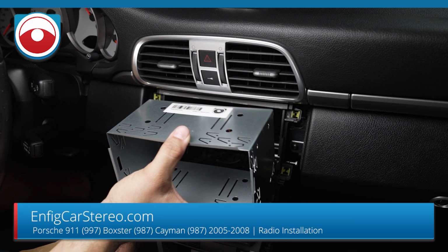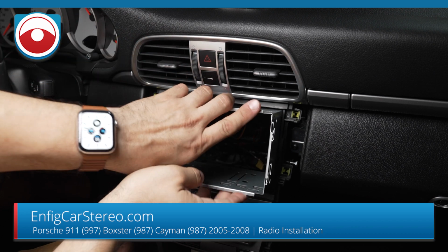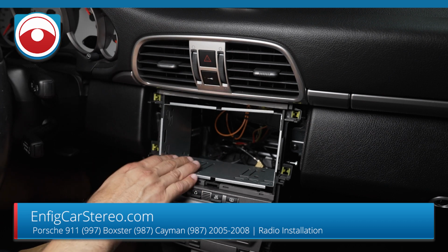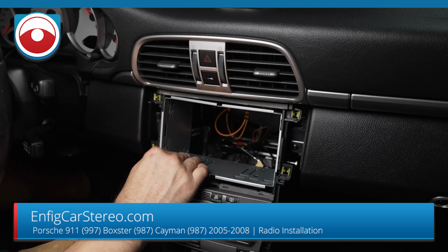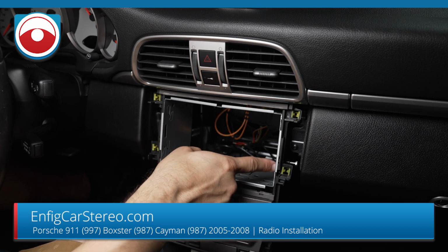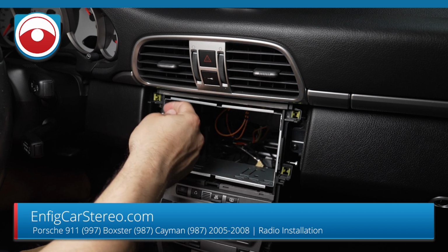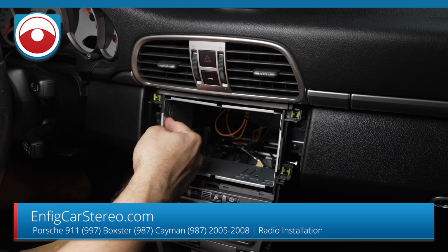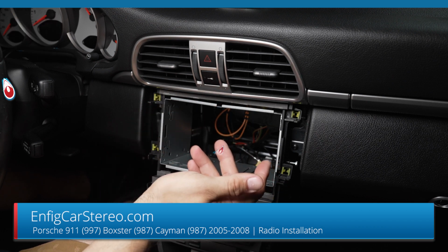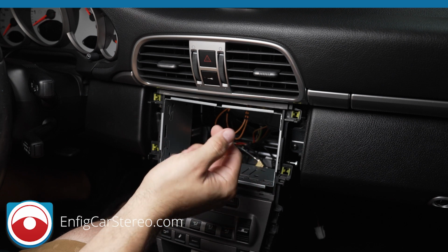You get the metal cage. This is a universal cage that we use in many of our kits. It's not made specific for this car. All right, now this goes in, and this is kind of designed to float in the middle. What I usually do is line it up and trace out where these holes are with a silver marker. Then I go in with the Dremel and cut it out, so that way I have places for this to bend. So it grabs. Not bad. I don't like doing it, but it's the only way to do it. And I'm sure consumers don't want to cut up their own car.